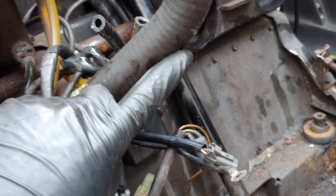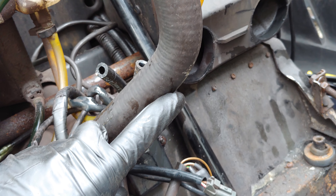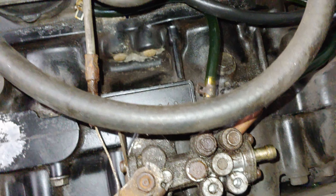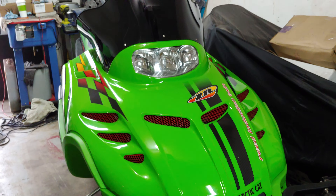When I took the fill cap off on this hose right here, the coolant was down. I don't know exactly what's going on — maybe it's the thermostat not opening. I want to try and find that out before I put this back in.